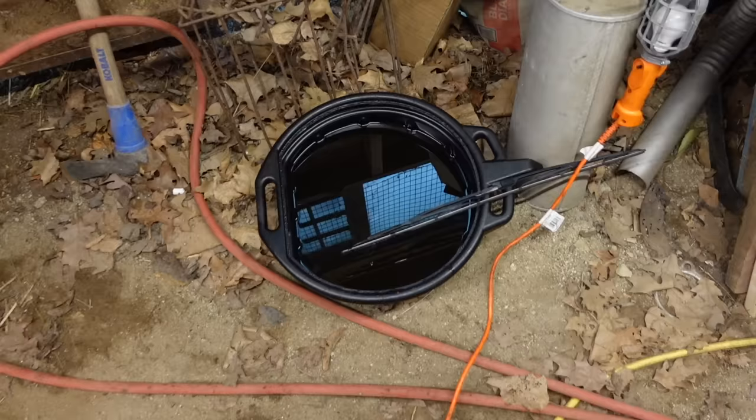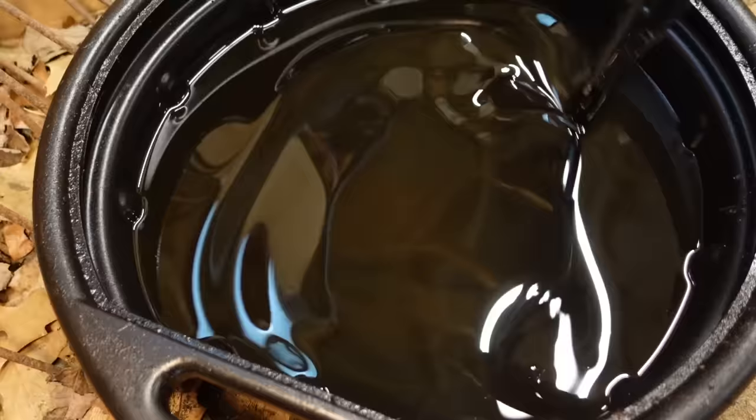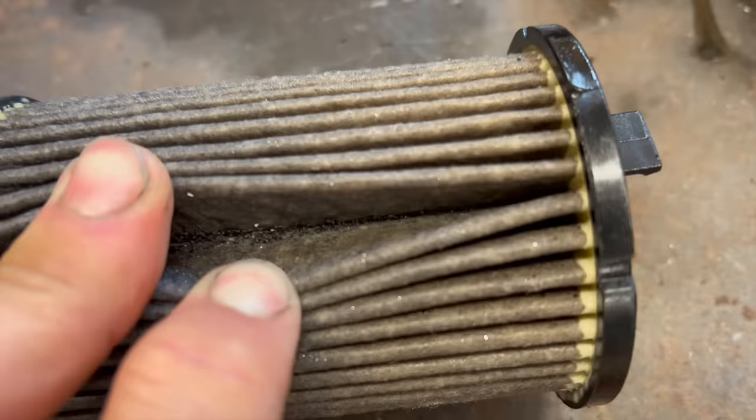In the shop — you might notice there's a different Land Rover behind me, but I'll get to that later. The oil that came out of the Range Rover looks like a pearl metallic paint, perhaps a shade of mocha. The metal flakes seem to be non-magnetic, so I assume they're bits of aluminum. The oil filter element, originally white in color, is also incredibly dirty for such a short drain interval. There are probably two possible scenarios: number one — which would be preferable — is that all that stuff was already sitting at the bottom of the oil pan built up over time, and adding the Sea Foam thinned the oil and stirred it up. If that's the case, the next oil change should come out clean.